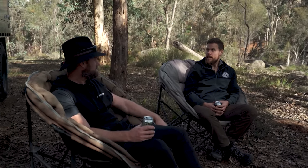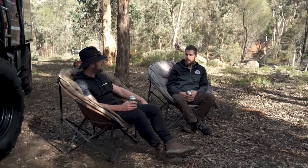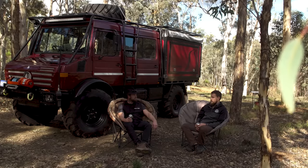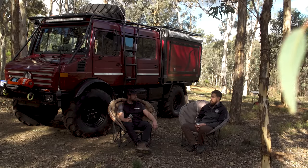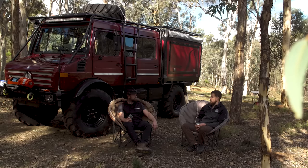Particularly with this truck, I do have an overdrive in it, which really helps. It gives you another sort of 20% of a gear ratio on the top. So when I'm cruising along, these tires are speed rated for 90 k's an hour. I normally hang around there or 85. I'm not trying to get anywhere too fast. I'm at about 1900 RPMs at 100 kilometers an hour.